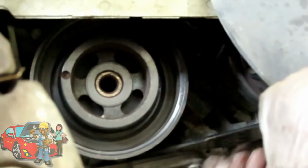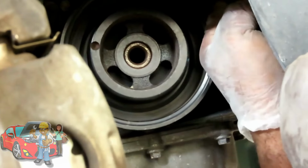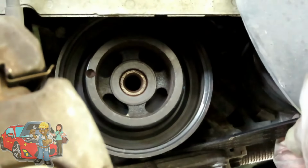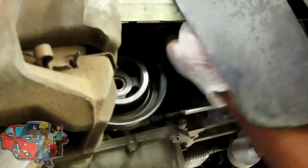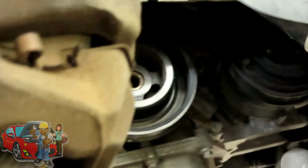You know what? Why don't you try a different pulley? What do you mean, a different pulley? You know, try using the tool on a different pulley. Well, how about if I try to push it? I'm pushing, trying to take it off of the AC compressor, but I'm trying to take it off towards the back. But this sucks. Okay. I just gained a little more play. Now, I'm up here at the water pump. Oh, sorry. Okay, good. Got that off, good.